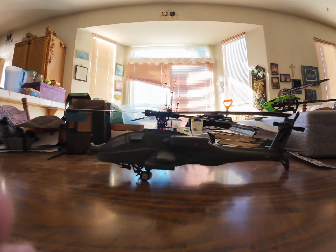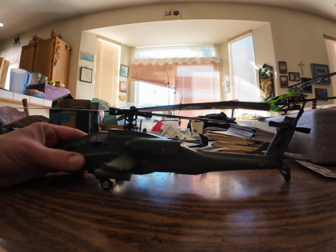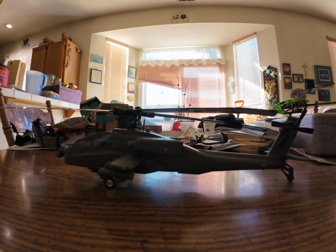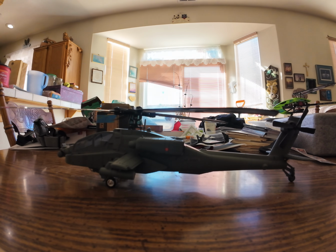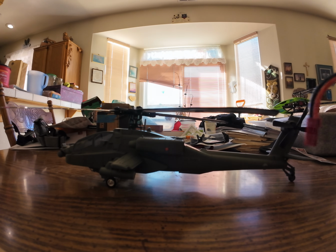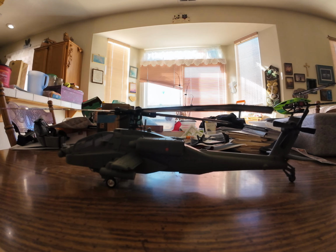And we'll come back, and now I want to digress back to the battery for these. The problem is, since these batteries aren't being made anymore, all the used ones are basically going to be shot right out of the package. They're going to be dead on arrival. When I got this, it came with it brand new in the little tab box that has the little clear window that you can put up on a hanging display. Right out of the box, one of the cells was at 272, and the other one was at 310. So it was shot brand new out of the box.